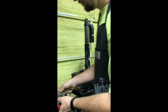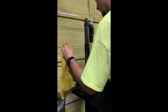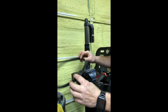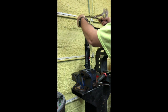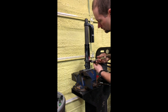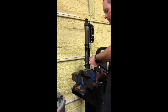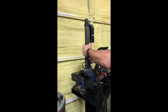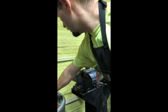After taking that off, I like to loosen the air sleeve next. Sometimes I use an old belt with vice grips — sometimes this works, sometimes it doesn't, depending on how tight the person who rebuilt it put it together. They're not supposed to be super tight, but sometimes they are. You put the vice grips up tight to the shock body and use the belt to spin it. This one is really tight though.